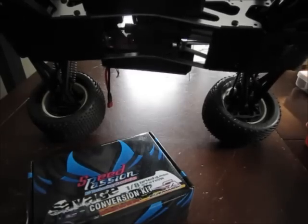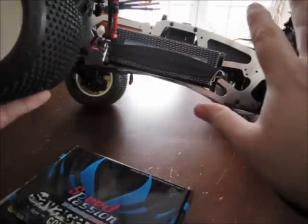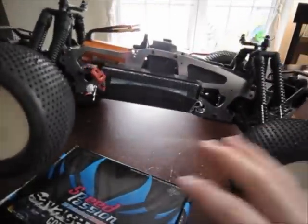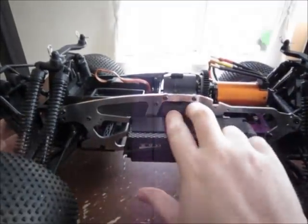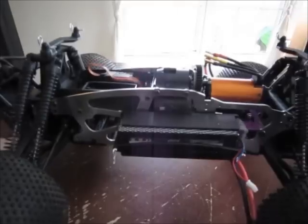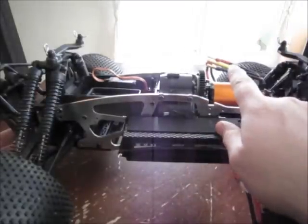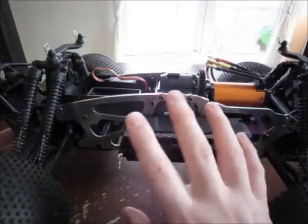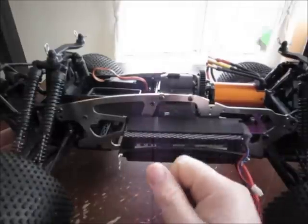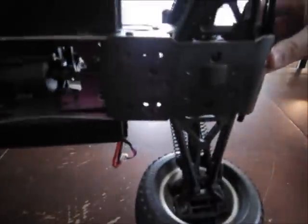They didn't come with any instructions. I just lined up the bolts where they would line up on the chassis without drilling, and that's the way they have it. I had to go ahead and buy hardware to mount these higher on both sides. Also, these trays don't feel very strong, so if you do this, use big washers or else your bolts will pull right through. The ones they give you won't work, so you have to buy new ones anyway. Make sure you get decent-sized washers so you get a good bite on the tray, otherwise you'll just pull the plastic through — useless.